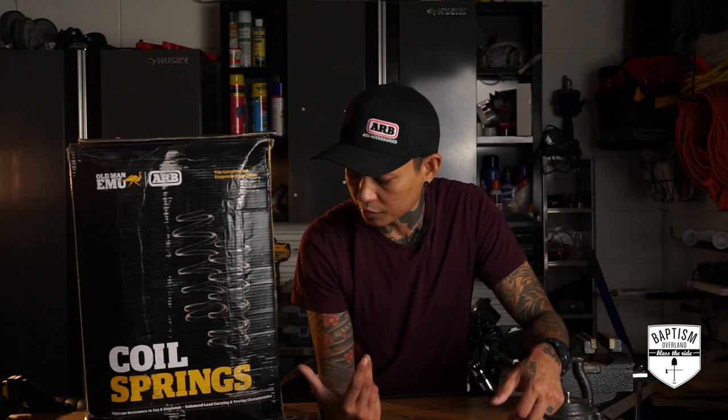We never really know what we're going to do with our vehicles until we get there. I didn't even think I was going to get a rooftop tent — I thought I was just going to get a trailer. So to combat that, instead of using spacers, I decided to upgrade the rear springs to the Old Man Emu heavier duty springs. I don't need to upgrade the front because when I put the OME heavy duty springs on the front, it was riding really high, and after adding the ARB steel bumper with a winch, it dropped about an inch and now it's perfect.